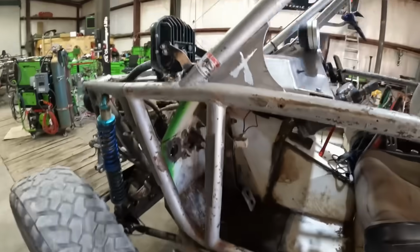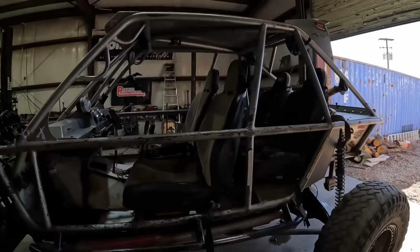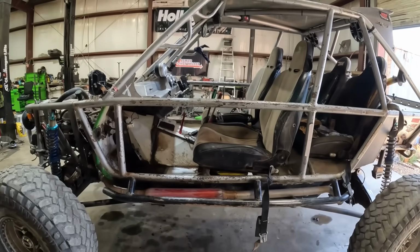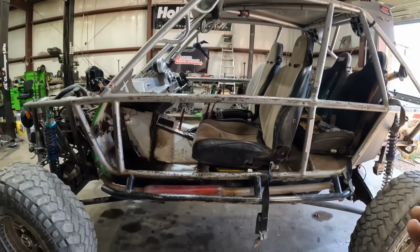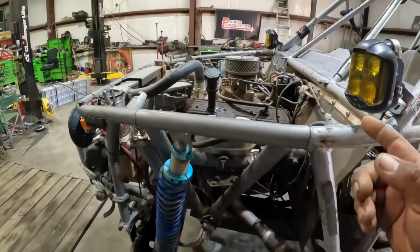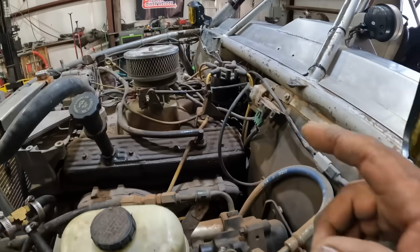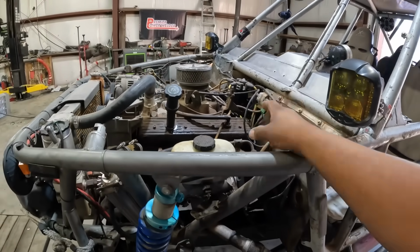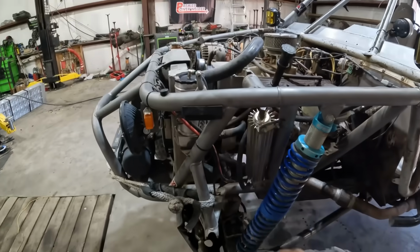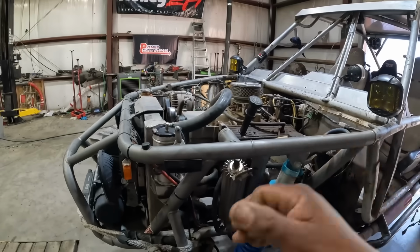All right, last night I got done wiring up the turn signal. That's all done. What else did I do? Oh, the oil leak. It's still leaking. I thought I fixed it, but it's coming out from behind. It's right at the intake and the block where it meets. It's just leaking out of there. And the dampener pulley, timing cover pulley, so I gotta pull that all apart, but I'm not gonna do that today.